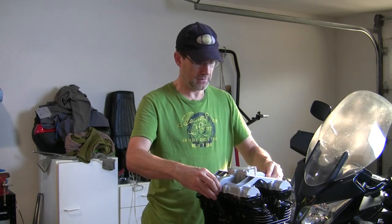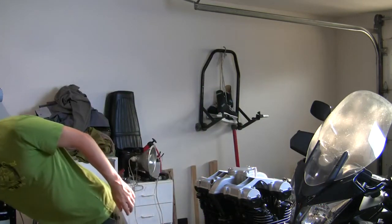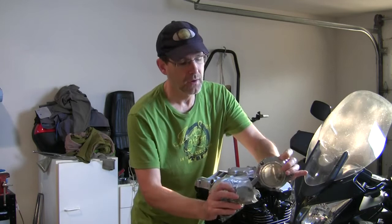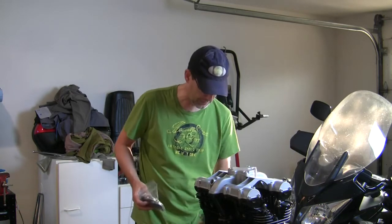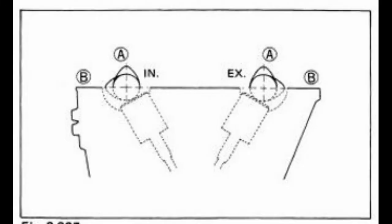I have now painted this valve cover. And the other thing we have to polish is the end caps — those are going to get that mirror-like finish. For valve clearance, we have to have the cams in a certain position — either A or B in this diagram. The clearance between them has to be 0.03 millimeters to 0.08 millimeters. I'm going to try to go a little bit toward 0.08 if I can.